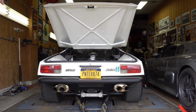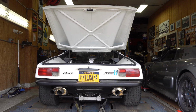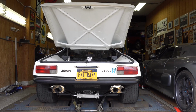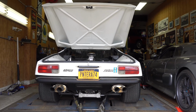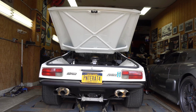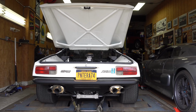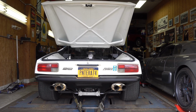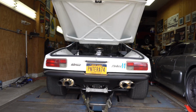One of the reasons why I want to get it tuned is there's a weird sort of dieseling effect that you get right around 1700 RPMs if you run it right at that point. I just think there's something quirky about the way it runs. 1800, 2000, no problem. Below it, like 1200, is fine. There's this weird dieseling thing that it does.